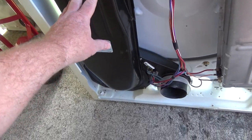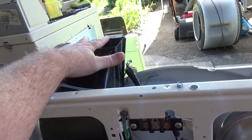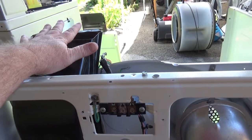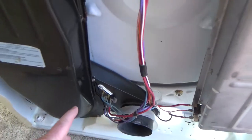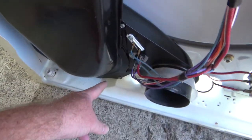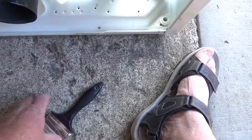Next I put on this piece — this is actually where your dryer filter goes. This is eventually where the lint filter area connects. It's pretty easy: it just takes two to four of those quarter-inch screws — one there, one down there, one there, and one there — and that just holds it in place.